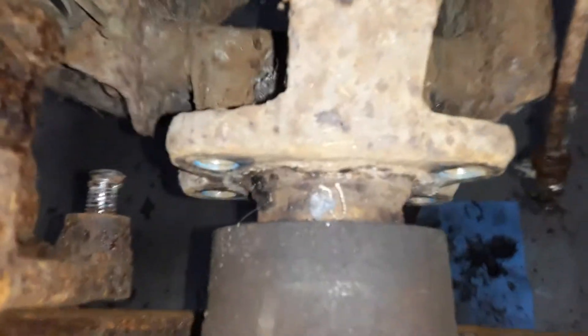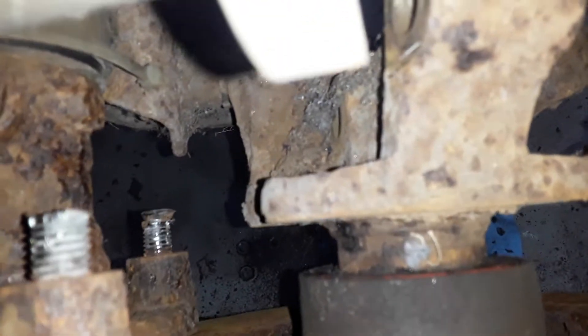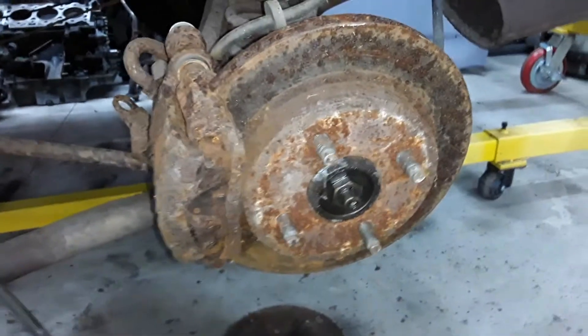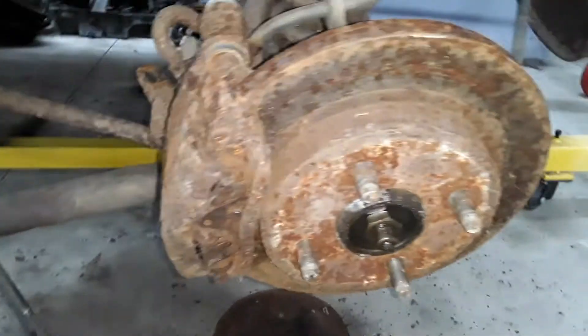Here you can see that I just need to make a plate to mount onto the spindle's four bolts that would normally hold the drum brake backing plate. Instead, all I have to do is make a plate that goes from that to this caliper bracket or mount. There will be a little bit of fudging to do because the two surfaces are off by about three-eighths of an inch — maybe a tad more because my bracket is warped and the caliper isn't perfectly square. These are just two rusty parts from a Contour I scrapped this year, but I saved its brakes to try doing mock-ups exactly like this. And yeah, who knew it worked so well.